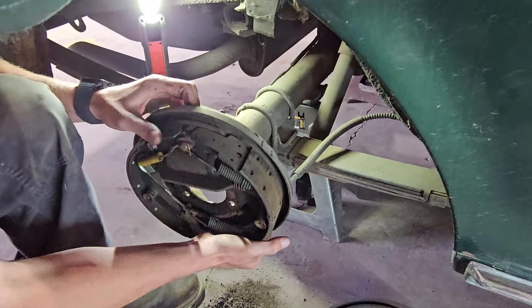Here are the new parking brake cables that come in the kit, but these things are way too short to use the original cable. The way we fixed that issue without making custom cables is we reused our old parking brake cables, removed the spring that was on the end, and installed them into the new brackets. Now our parking brake is fully functional, running the full length of the car just like factory. Let's get our new 15-inch wheels and tires on the car. One thing to remember with this or any disc brake kit is they require 15-inch wheels or larger.